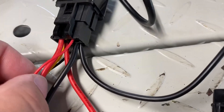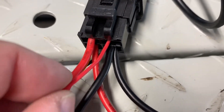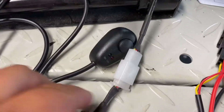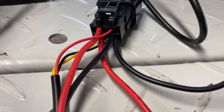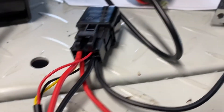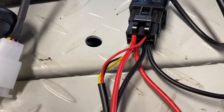The last pin, which is going to be pin number 86, is this red wire. And that is also connected to the switch — that's the red wire in that. That basically concludes your four pin connections. That's the same as any other relay, regardless if you buy one of these and wire it yourself. The concept and how to wire up a relay is still exactly the same.